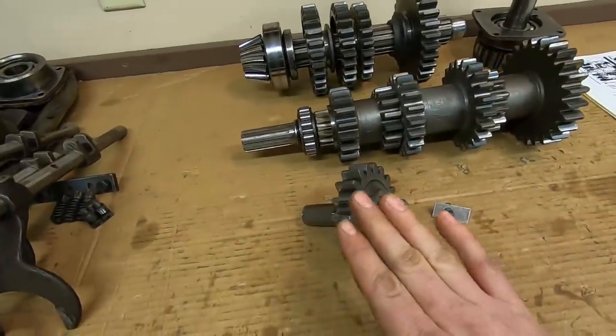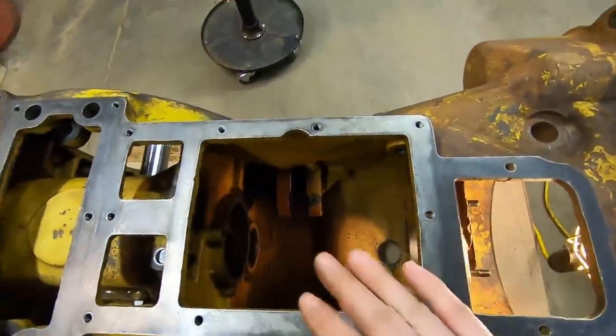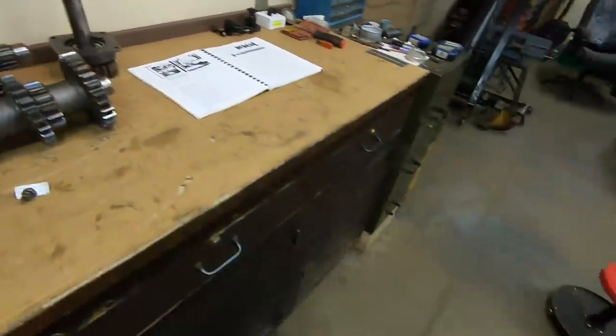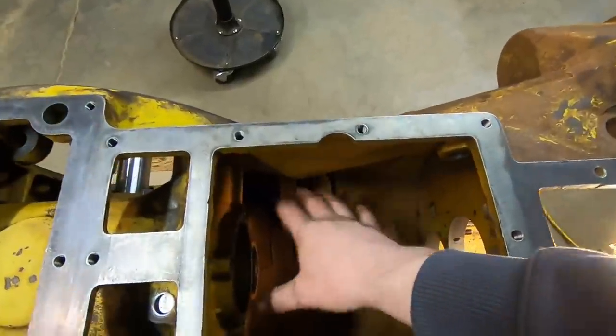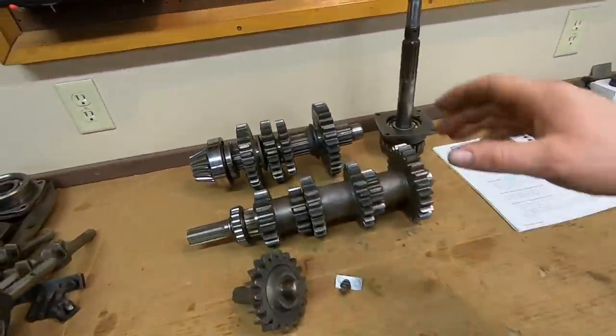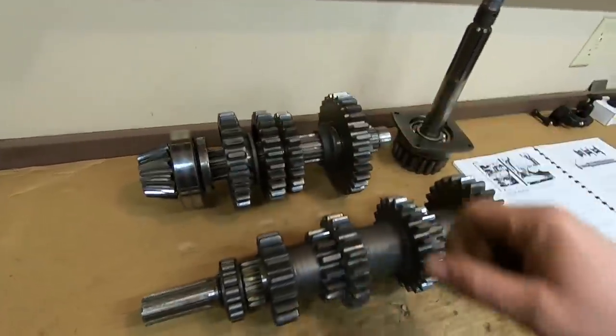At this point I'm going to throw the reverse idler gear and the countershaft into the bottom of this case. The reason we're going that route instead of just bolting the pinion in and finalizing all gear adjustments is because all that stuff can stay down in the bottom of the case and won't be in our way for the pinion adjustments. If we just threw the pinion in now we could get it all figured out today, but then we'd be taking all this stuff back out just to put these pieces back in the bottom anyhow. I'm trying to follow the most efficient path - one and done.